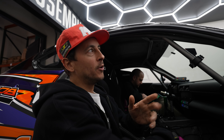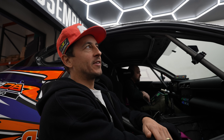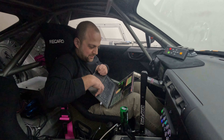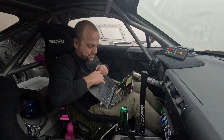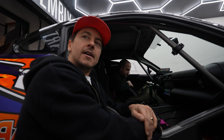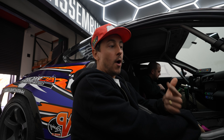First quick little pull — obviously we're going through some issues so we're not really able to tune it yet, but we almost just hit 450 horsepower. Roman breaks it down: just no timing, low boost — seven pounds of boost, only ran it to 6,400 RPM. So about 450 on seven pounds of boost with no timing yet. We're still working through the fuel pump and water pump issues before we can really get some big numbers out of this thing.